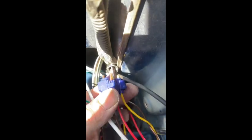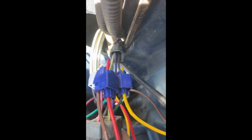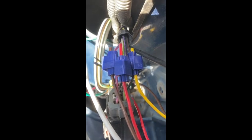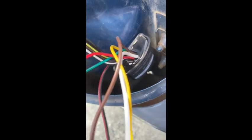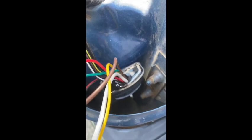Testing the passenger side or right signal — it's coming off the brown and red. Didn't have a lot of room to work with, but I had to peel the loom back just a little bit to give me more room. Just in case anything ever messes up, I could still snip these off, put a connector on there, and tie it back in to the original. I'm going to leave a little extra wiring on there just in case. The double-sided tape holds really nicely, so looks like we can button this up and give it a test.